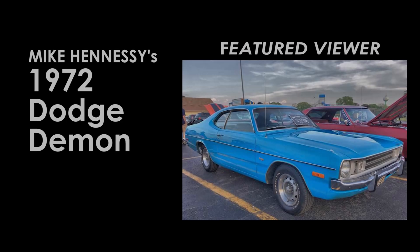My biggest takeaway: always get an alignment after you adjust your torsion bars. If you raise the car your wheels will probably be tilted out; if you lower it they'll be tilted in. That'll do it for today's video — I really hope this helped you understand how torsion bar suspension works and how to adjust it properly. It won't apply to every vehicle with torsion bar suspension, but hopefully it gives you a better idea. Thank you so much for watching; please leave a like, leave a comment, and check out the playlist on this car on my channel.